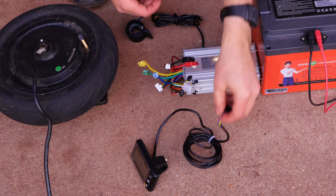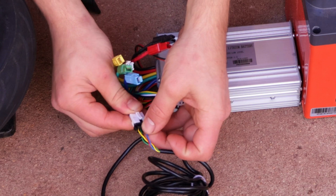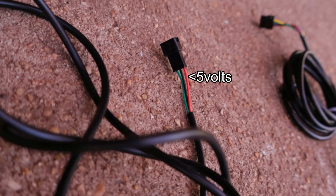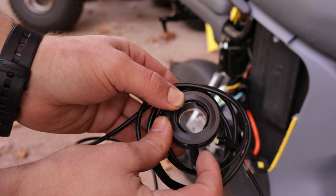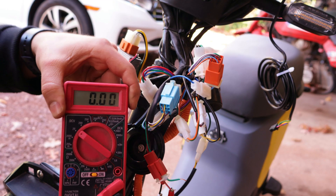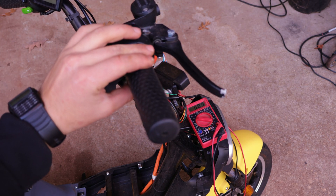When hooking up the display to the motor controller, connecting this cable to the controller should be plug and play — except if you're not using the included one. Moving on to the throttle, which will always have a red wire for 5 volts, a black wire for ground, and a third wire — sometimes green or white — which is the signal wire, giving us higher voltage the more it is twisted. For example, if we connect a small lithium-ion battery to the red and black wire from the throttle and connect a multimeter to the black and green wire, we can see the voltage go up the more we twist it.